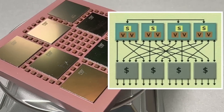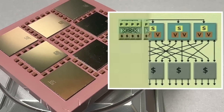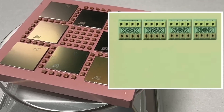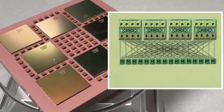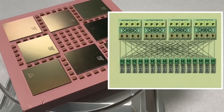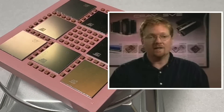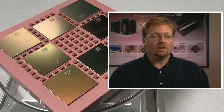It has ports leading off to the memory subsystem on the board. If you take a look at a board, it contains four multi-stream processors with a crossbar to a flat shared memory. The memory is controlled by 16 memory control chips, each one of which has eight direct RAM bus ports to a very high bandwidth memory subsystem. So you have a system building block that has four multi-stream processors and flat, low-latency shared access to the local node memory.